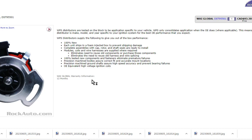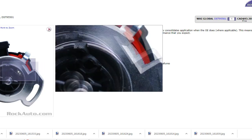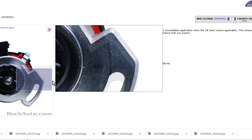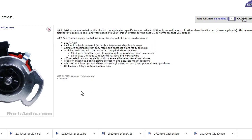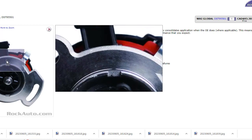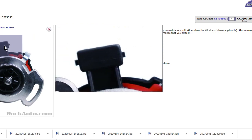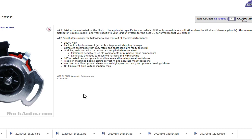For those who don't know, the Eurovan 5-cylinder engine only has a camshaft position sensor, which is basically the hall sensor inside the distributor. There is no crankshaft position sensor. So if this sensor fails, the engine stops running. On vehicles that have crankshaft position sensors or engine speed sensors as well as a camshaft position sensor, if the camshaft position sensor fails, the engine will still continue to run even when it has a distributor. I've got videos on my channel where I unplug the hall sensor on the distributor while the vehicle is running, and the vehicle continues to run because the computer relies on the crankshaft position sensor.